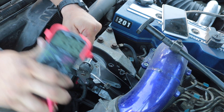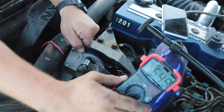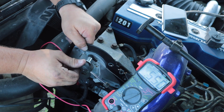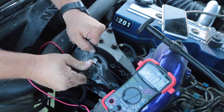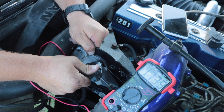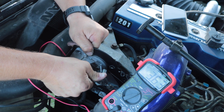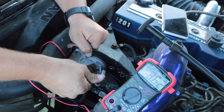It's going to be hard to show you guys — can you see that? We're looking for smooth voltage from idle to full throttle with no dead spots. Going nice and slow, it should just climb nice and easy — up to 3.63 at full throttle, no dead spots.